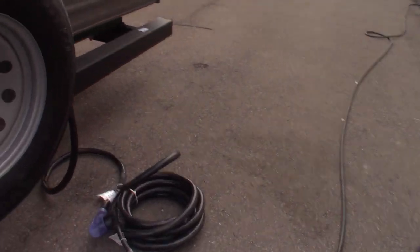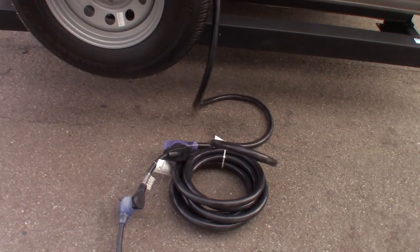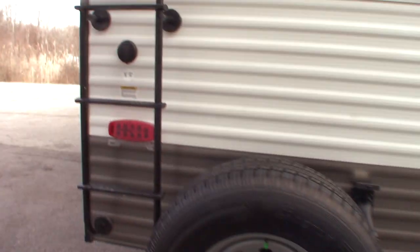This is your cord — it's a 50-amp shore power cord. You get this reducer with it to reduce it down to 30 amp, and I showed you the other one up in the pass-through compartment that'll take it down to 20 amp, so you can plug into anything. This is just cable and satellite through here.